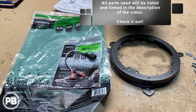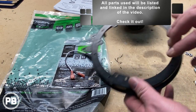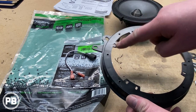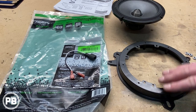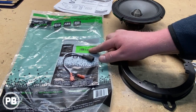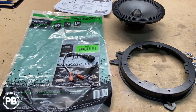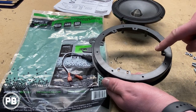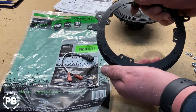For six and a half inch speakers, they come like this. It does accommodate a five and a quarter, but if you don't have a five and a quarter, you can break these tabs off in the center, which we're going to do. For the wiring harness adapter, you need the Metra 72-8109 — that'll plug directly into the speaker and into the factory plug itself. So we need to break these tabs off in the center to prep this for the door.